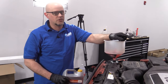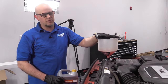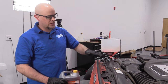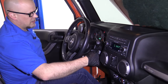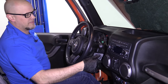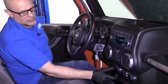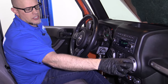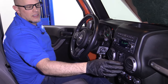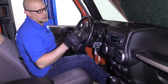You do not want it to overheat. Once that's all set, I can shut the vehicle down for a while, let it cool down, recheck the level, and then take it for a road test. Now I'm just going to start the car up. It's always a good idea to put the heat on and put it on hot, and just constantly check it — make sure that you actually get heat. If you're not getting heat, there's probably not enough coolant in the system.